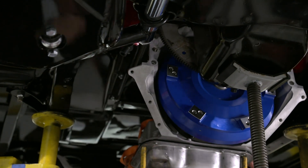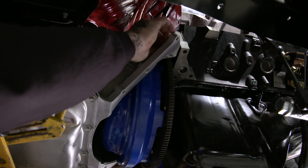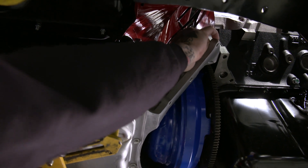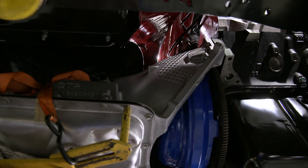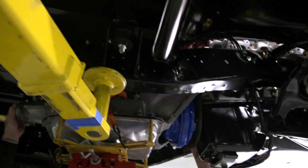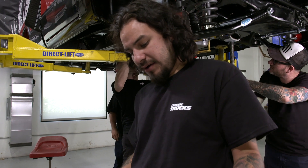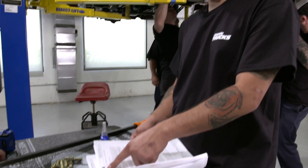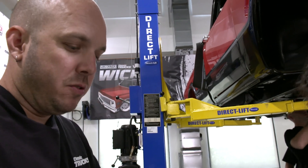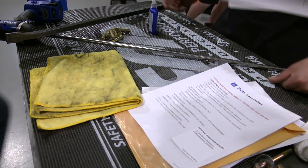Are you gonna go up or what? Yeah, I'm just making sure the angle's right because it's kind of off. Let's go, Peter. How are you looking over there now? That should do it. Are you in the dowel pin, Jay? Yeah. Chris, let's start bolting up the torque converter. Flywheel to the converter — 60 foot pounds. You know French? Je m'appelle Jean Cousteau.